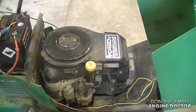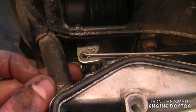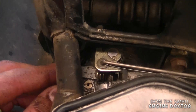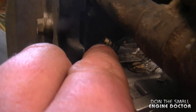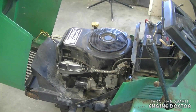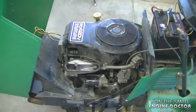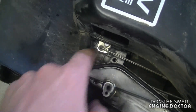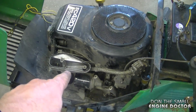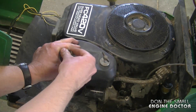I'm pretty happy with that — it's hard to get everything perfect when an engine is that old, at least 25 years. The screw I was adjusting is the idle speed screw; I turned it out for it to idle slower but then it didn't idle well, so I turned out the other adjusting screw on the side — turning it out two turns made it idle a lot better. Now you know when your engine surges what the problem could be. It may not always be a dirty carburetor; sometimes you may need to replace the carburetor kit including all the jets, or replace the fuel pump if it's not pumping enough fuel. Once you're done, make sure to put the air filter back on. Thanks for watching guys, make sure to subscribe and we'll see you next time.